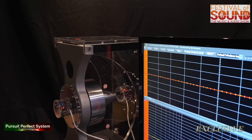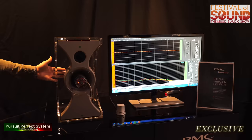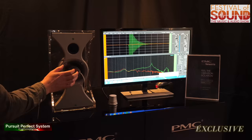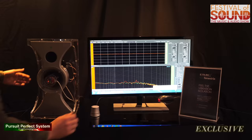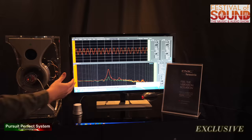So what we're doing is we're rigidly mounting these plates at the top and at the bottom to the cabinets. You can see they screw up into this. And then here we've got the nest of the mid-range section, which basically floats on gel mounts. There are small gel rings in here that are pushed in, and that lets the whole section float. So what we've got on this jig here is accelerometers on the front and on the back. On the back it's basically simulating the cabinet, and on the front it's showing what vibrations would make it through from the cabinet onto the mid-range section. The back is exciting with tactile transducers — basically small drive units without the cone — causing vibration into the cabinet, simulating what happens when the loudspeaker is playing.